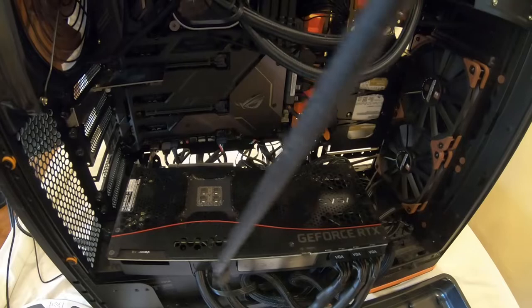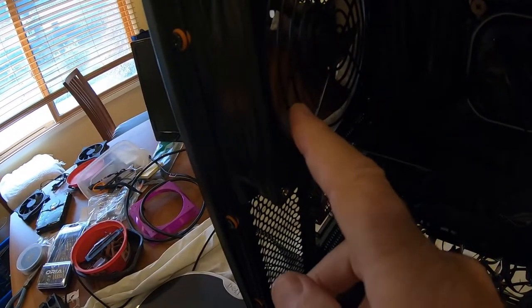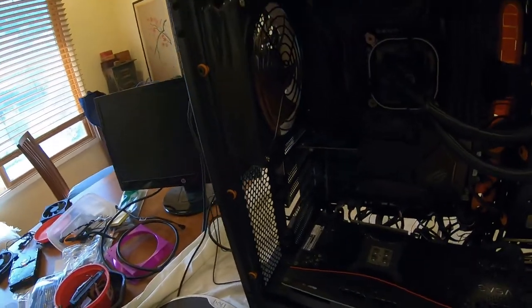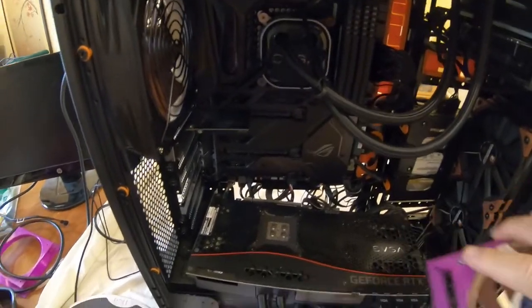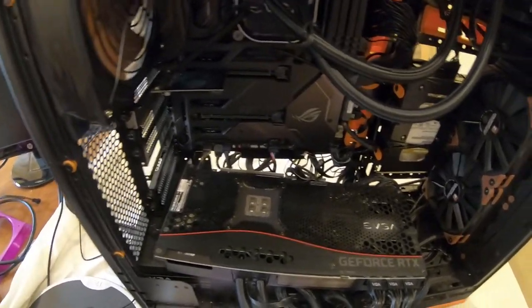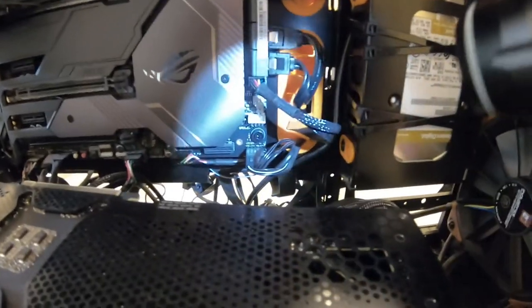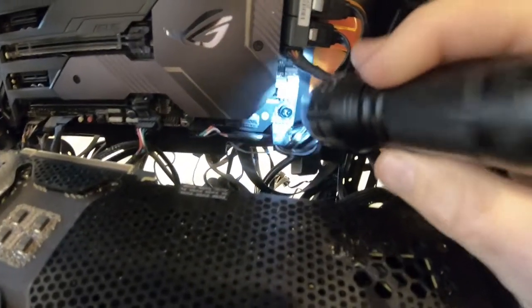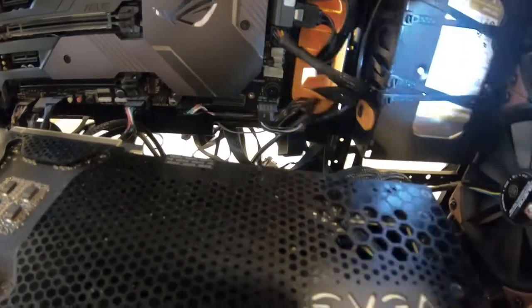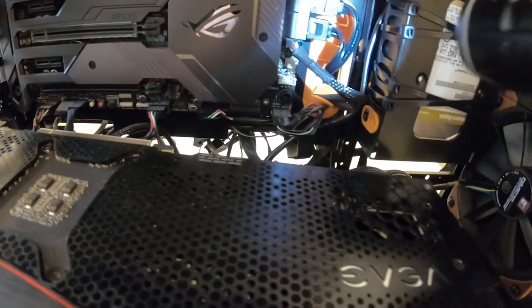We need two new fan headers that we're not using for these fans. This is a 1600 RPM fan, and our original idea was to hook it up to this one, but this is a 1500 RPM fan. I don't want to hook these two fans together using a splitter because this one's going to have different characteristics. And this fan is a 2000 RPM fan, so we can't hook these up together. We have two fan headers left we haven't used. One is chassis fan 3, which is down here — there's a connector right here, that's why I removed the graphics card. I was using this before when I had my push-pull AIO on the front with all identical fans, so we're going to use this one for one of the fans.